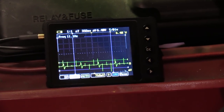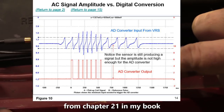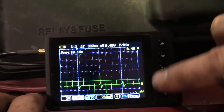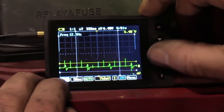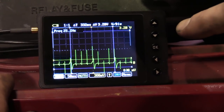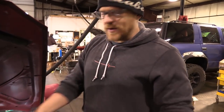It's right on that threshold of where that won't be seen. What I teach is anything less than 500 millivolt peak to peak is suspect. On this scope I'm set at a half a volt per division. We're over a half a volt, so ignore the spikes — just look at the sine wave. That's at least one division — you're more than a half a volt. So there's no reason for me to go in and try to adjust this air gap yet. I think these extra pulses are affecting what the computer is seeing on this signal.